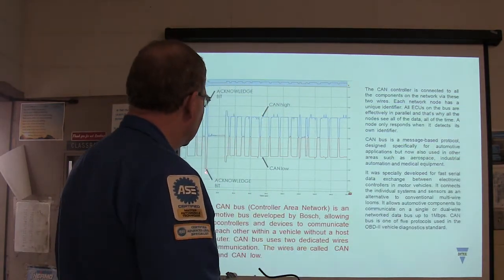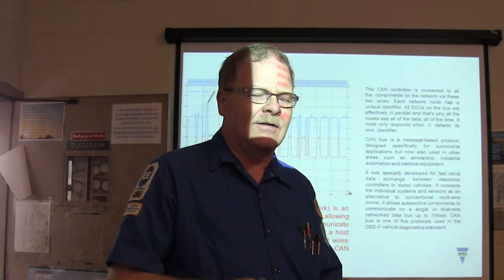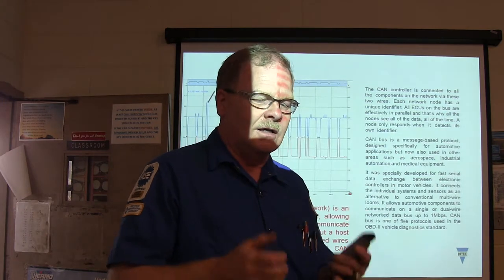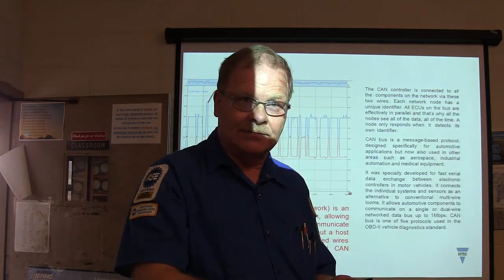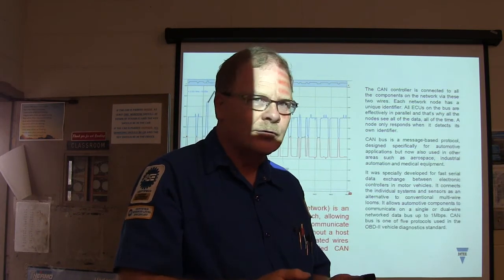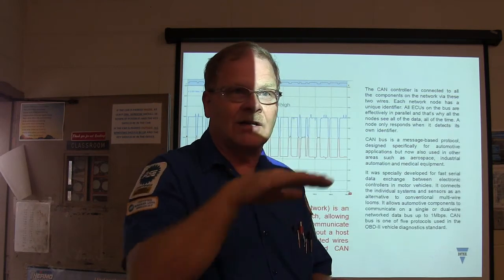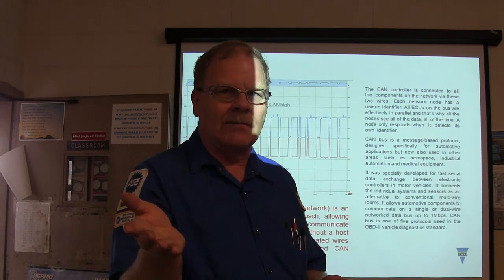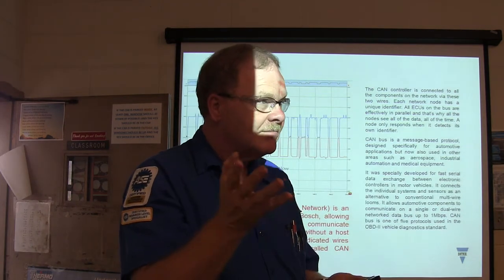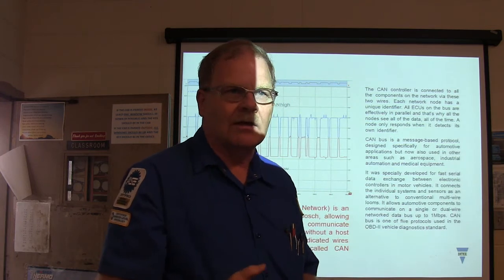So basically, remember if you're looking at a vehicle and trying to find out what's going on with something that's not working, like the instrument cluster or whatever, you do that full scan like you're talking about. That's the one I'm always fussing about, because when y'all are just pulling the code out of a PCM, you do the auto scan and you gotta sit there and wait a while. Go ahead and do the auto scan and see which module's not talking. If it's got that module on it and it ain't talking, you need to find out why. Powers, grounds, connections, salt corrosion in the connector, whatever. Make sure you do that.